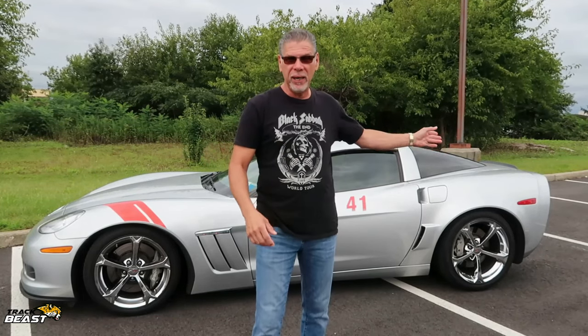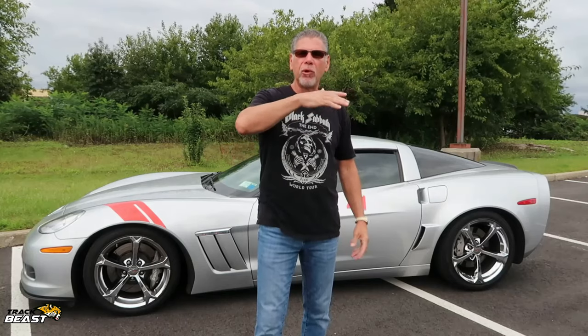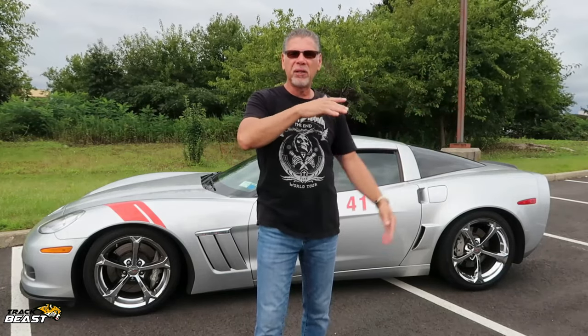So I ended up changing the transmission mounts to a solid transmission mount and took out the rubber ones. But why I did this is, it's a rear transmission that is bolted directly to the rear end. So it's not a transaxle, which means the transmission and axle are all one, like a Porsche or a rear engine car. It's actually a regular 6-speed manual bolted in the back, bolted directly to the rear end with a torque tube taking the power from the motor and putting it to the transmission, which gives you a nice weight balance because you could probably get 50-50 weight distribution out of this car because the transmission's in the rear. If the transmission moves and the rear is bolted to the transmission, that could make the rear unstable. So I put the transmission mount in and it made a huge difference.